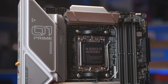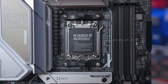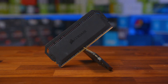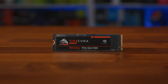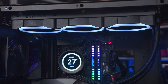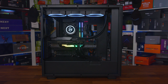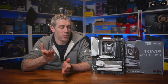With motherboards, the board itself will never lend tonnes of extra performance, but instead we look at whether the board aligns with others that utilise the same chipset, to make sure it performs within the range we expect. To do this, we put the board onto our test bench with the Ryzen 9 7900X, coupled with 32GB of Corsair Dominator Platinum 5200MHz memory. We also used a Seagate FireCuda 530 1TB drive, a Palit RTX 3080 Gamerock OC, and an NZXT Kraken Z73 RGB cooler, with everything housed inside an NZXT H7 Flow with all side panels installed to simulate real-world usage — something extremely important when looking at VRM temperatures.